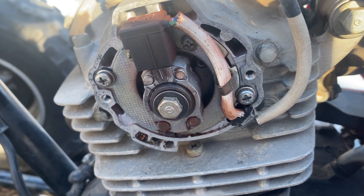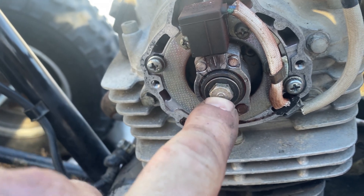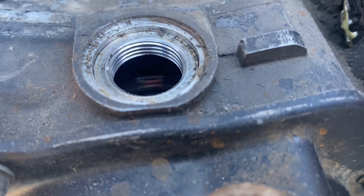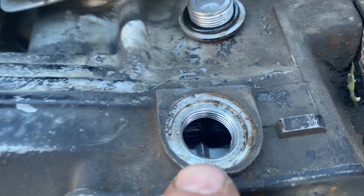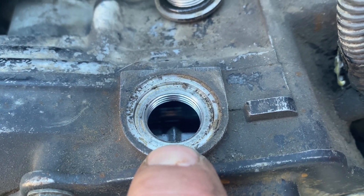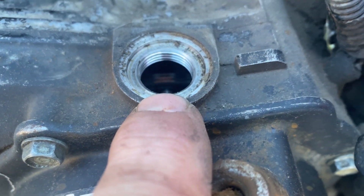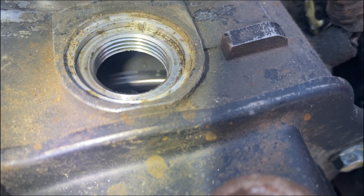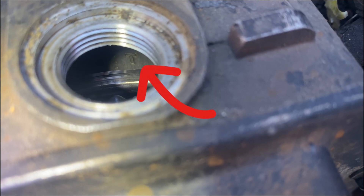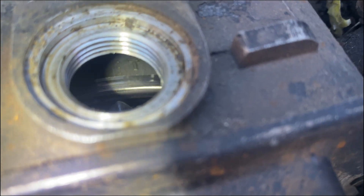As you can see there's a line here and here. You're gonna turn the motor until this lines up, and then you're gonna look in the hole with a flashlight to see if you can see the T — and the T should line up. You can just barely see the T there it is, and you can see the end of the indicator. Clearly this is not lined up, so the timing chain has jumped a tooth.